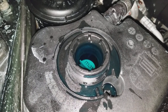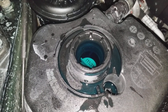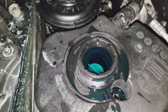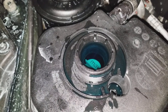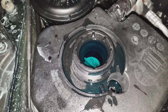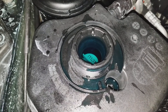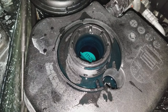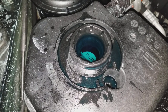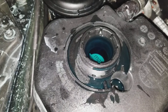Some other videos say it only takes 12 minutes — for me, I like to make sure the car is not going to overheat. Any air pockets you leave in there, and if for some reason your temperature sensor isn't working and you don't hear the car overheating, you can blow a head gasket or the head itself — and that's going to be one expensive repair.